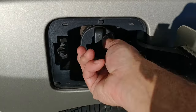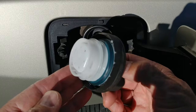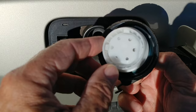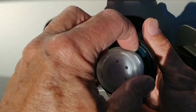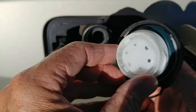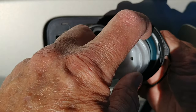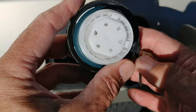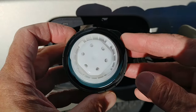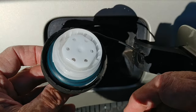I inspected the cap and took a look at the inside and the seal. See this blue gasket down around here? That's what seals against the tank, and it looks pretty good all around. It just feels kind of hard — it doesn't feel resilient and flexible. But this is a valve. There's a one-way valve inside of this that lets air into the tank and doesn't let air escape, and it could be that there's a failure in there.